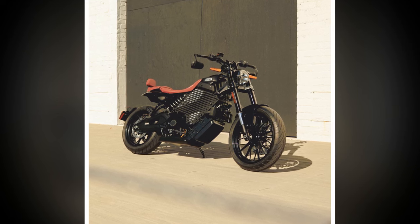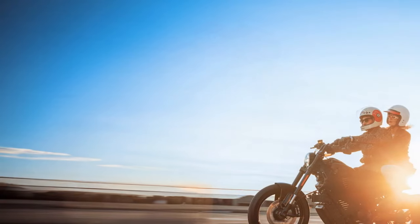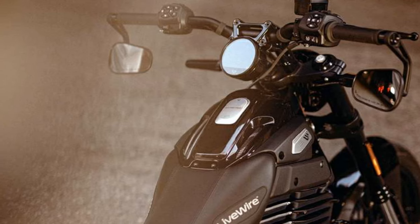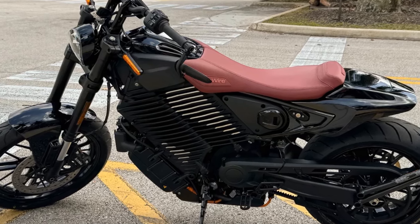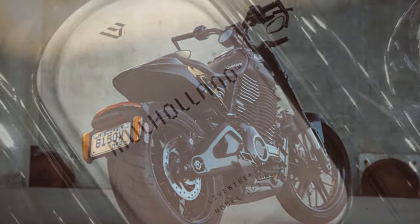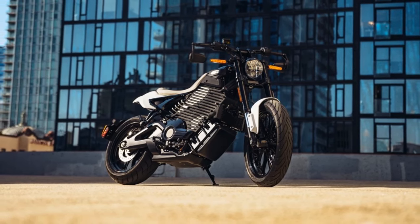Here in the hills, pushing the Mulholland to its limits and asking the most from it, it shines. 0-60 mph is achieved in a claimed 3.3 seconds with the electric motor's claimed 194 lb-ft of torque. A Brembo Monoblock 4-piston caliper provides excellent stopping power and incredible brake feel at the lever, allowing a high level of control. Ergonomics are comfortable and relaxed but upright enough to put some weight on the foot pegs, move your body, and maximize lean angle. The 43mm inverted fork is fully adjustable and a progressively linked monoshock is preload and rebound adjustable, giving the Mulholland a plush but stable feel on the highway while staying composed pushed hard through the turns.